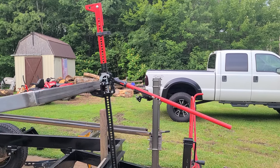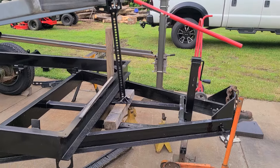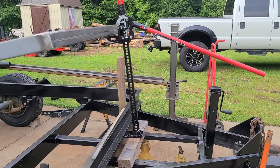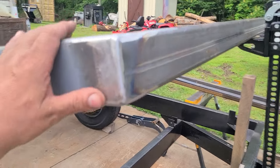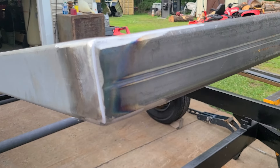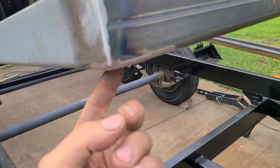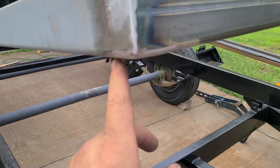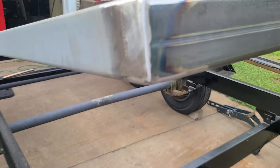This is that jack I got from Harbor Freight - I think it's a 60 inch. It'll go up higher but it's a little sketchy so I don't want to leave it like that. We got everything closed off real nice and sanded. When I'm done with this I'm going to drill holes in the bottom for moisture to get out, and I'm going to run fluid film on the inside channels after it's painted.